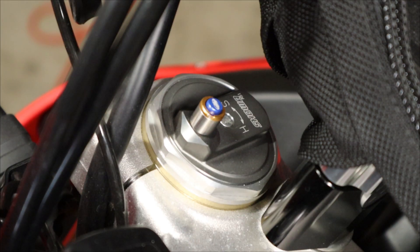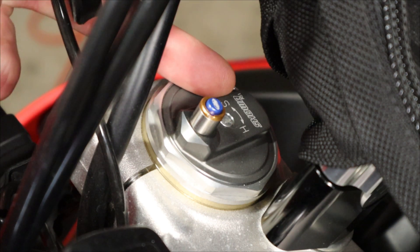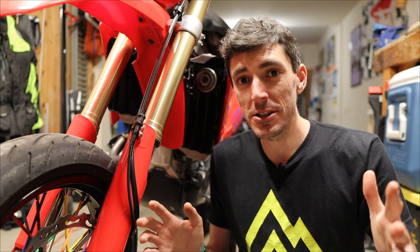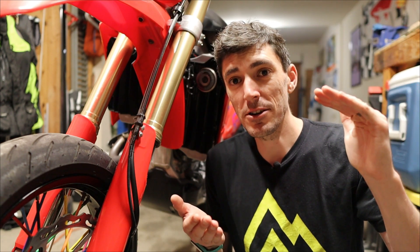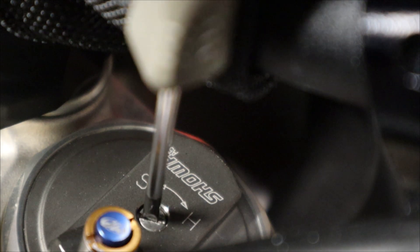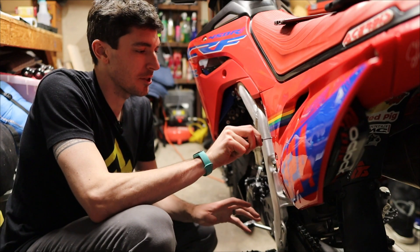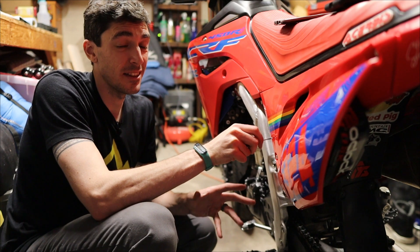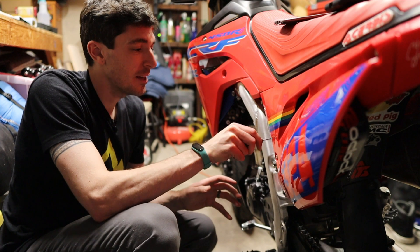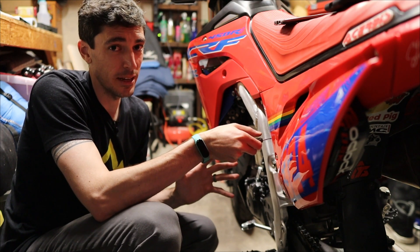First, some basic concepts. Your suspension has adjustments that affect handling: compression up top and rebound down below. Compression determines how quickly or slowly your suspension compresses when hit, and rebound determines how quickly or slowly it reverts back to its normal state — all easily adjusted with a screwdriver. Personally, I've hardened the compression and rebound just a couple of clicks for my supermoto setup. But there's a bigger adjustment I haven't yet done, and that's rider sag. Rider sag helps determine your spring rate and preload, and it should probably be done before clicking away at everything.